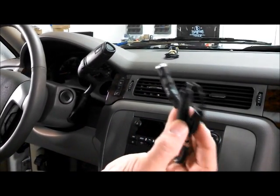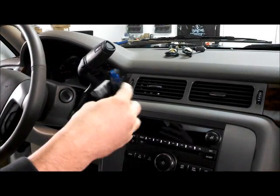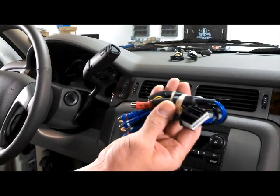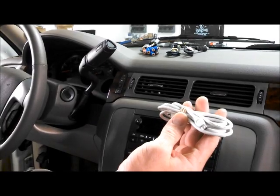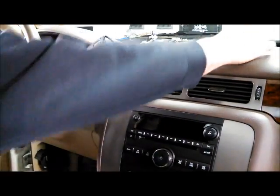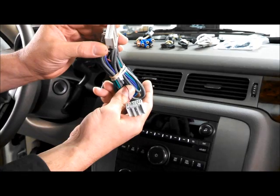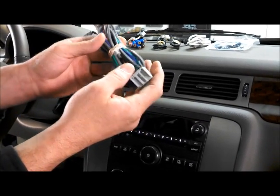This all-black cable with two very different ends is for the antenna adapter. If your vehicle has rear seat entertainment or you're adding a screen, the black plug with the various RCAs coming off of it is for the video AV in and out. The white cable is the new USB. She has the GPS antenna. And lastly, this harnessing with one larger 20-pin connector has to do with the camera and vehicle speed; the smaller gray connector goes to the OnStar module.